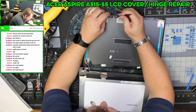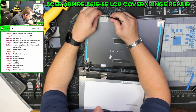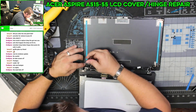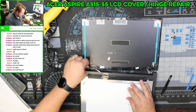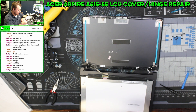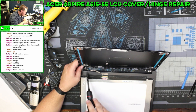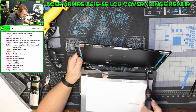We're going to go through the same process we did with the Wi-Fi cables, just on this side. Make sure these cables stay attached. Once you get it past that first little bend it should be fine. Tilt these hinges to the direction they're supposed to go, reattach, and switch to the small screwdriver. Make sure the screws are nice and secure — don't over-tighten them to the point where they strip out.